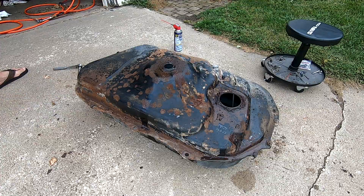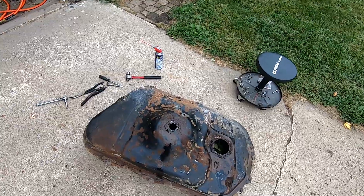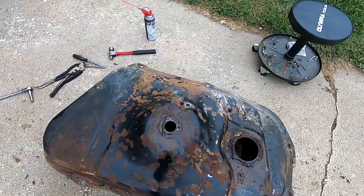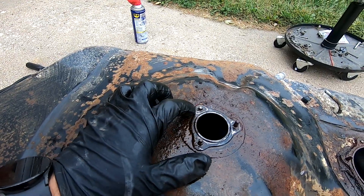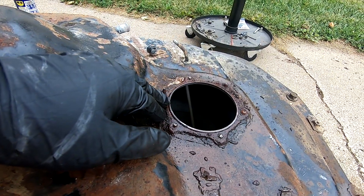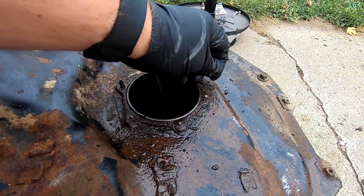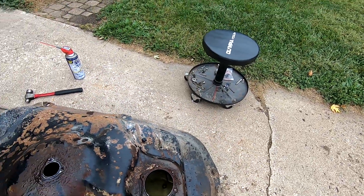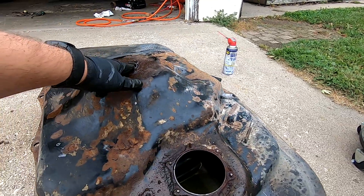Off time warp. As you can see, I had some success on those eight-millimeter bolts. On the relief valve I only snapped one off — I got a little too aggressive. But on the pump itself where the hanger is, I only got one out and everything else just snapped. You can see the stuff was pretty well corroded. I am correct — that is the return line there, and that's the vent.